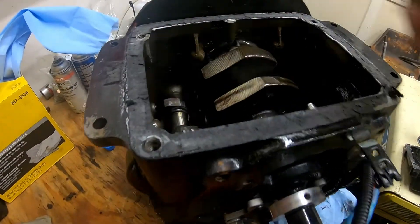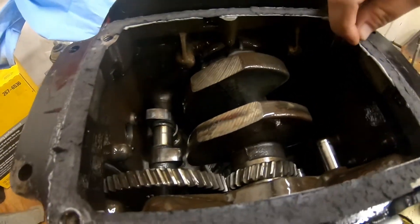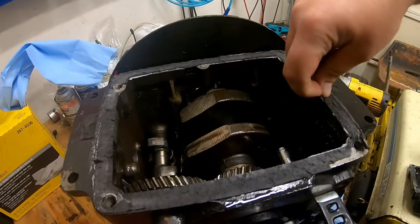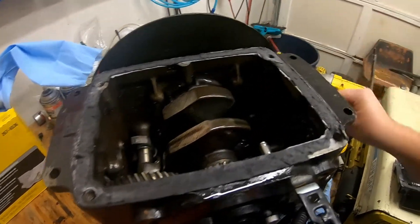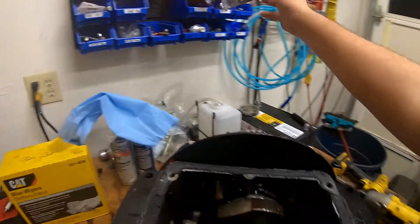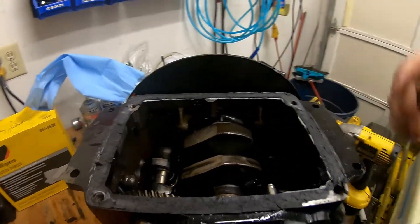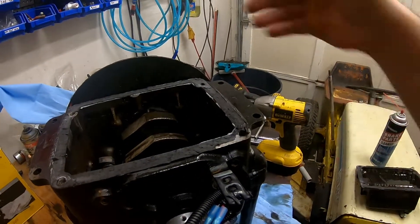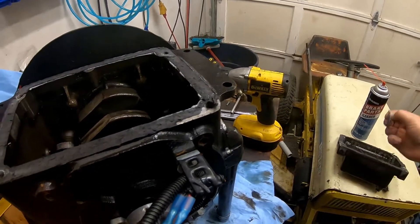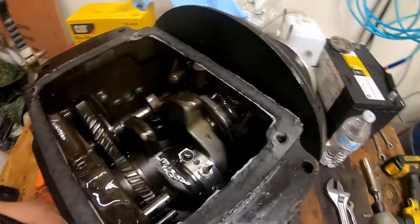I'm not real sure where it was leaking but I know that pan is warped now. Last time I put a gasket and ultra gray advanced formula gasket maker — put some of that on one side. I probably should have put it on the pan side too but I didn't, and it still leaked.